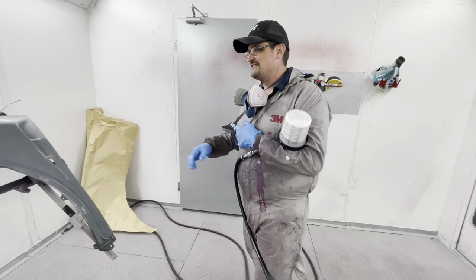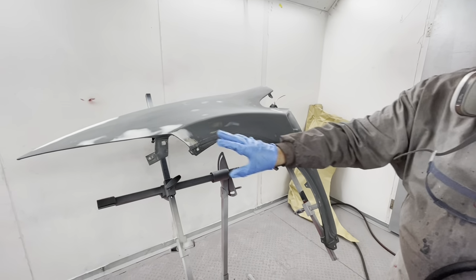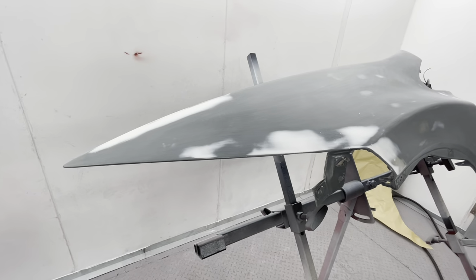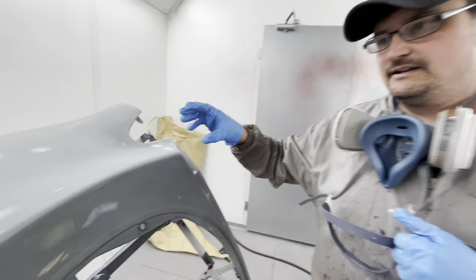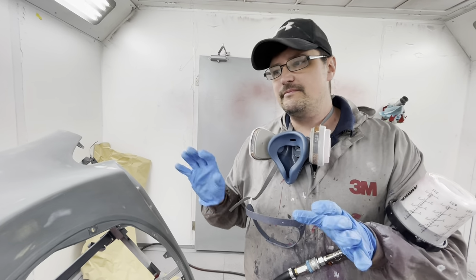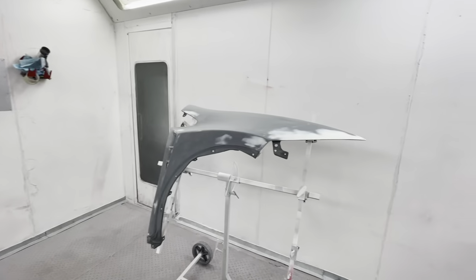We're only joking. Fiberglass wing, fiberglass wing, fiberglass bonnet. Doing some repairs, filled in some discrepancies. Obviously, it's fiberglass, it's never going to be perfect, is it? So what we need to do is prime it now, and then check over it, fill in any holes or imperfections, and probably end up priming them again. This one's had a bit of work.